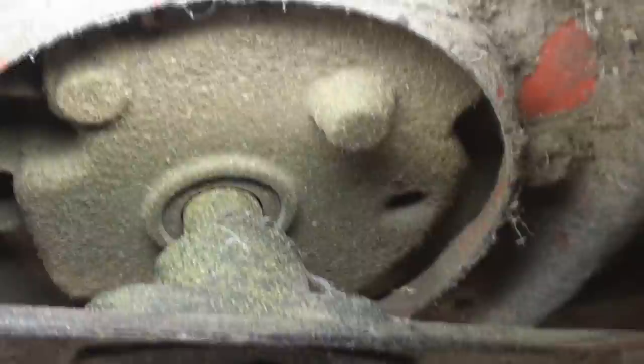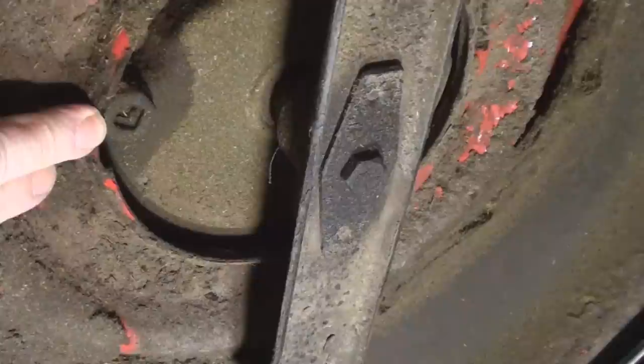We're going under and we'll have a look. While we're in here we'll take a look at the main seal on the end of the crankshaft. It looks nice and dry so there's nothing to worry about there — we're not losing any crankcase oil. There's oil residue built up around the drain plug, so either the drain plug's been weeping a little bit or it's spillage from above. It's a three-eighths inch square drive.